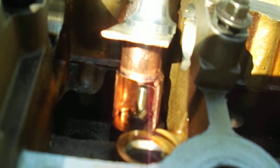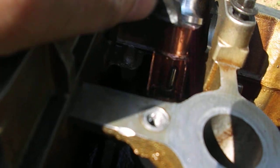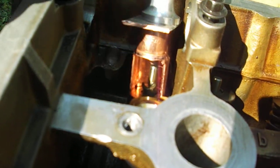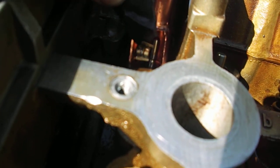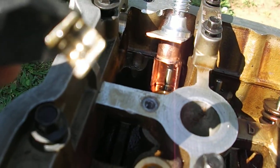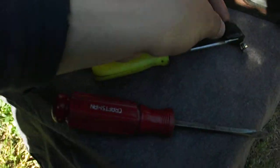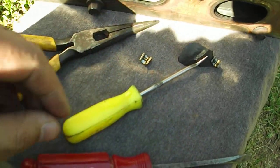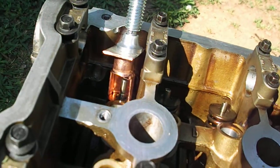I've already compressed it down, so you can simply use a piece of magnet to take out the keepers. The keeper will just stick right onto the magnet. I already took out the one on the inside. You're just gonna use this pointy screwdriver and kind of push the other keeper over or out, and it will just automatically come right out.